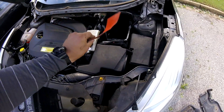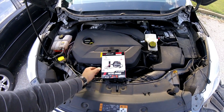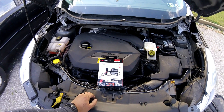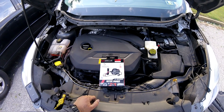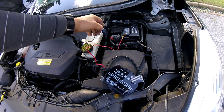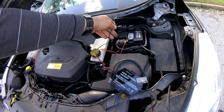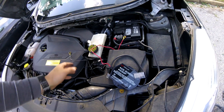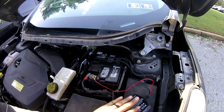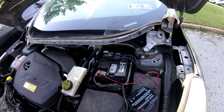I'm going to place the pad in the bottom just like that. While I have the battery open and exposed, I'm also going to install a 1.5-amp battery maintainer made by Schumacher, bought off Amazon — same one I installed on my truck. I just need to find somewhere to mount it. I'll connect the leads to the respective battery terminals, red to red, black to black, by removing the nuts and sliding the rings over. Now I have the leads hooked onto the car battery.